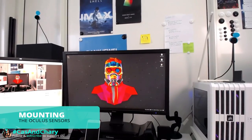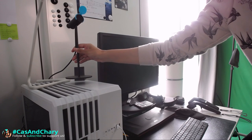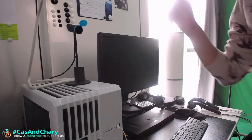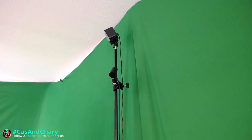The Oculus Home setup is pretty great and really gets the job well done. But if you still have some tracking issues, here are some things we do to get it as optimal as possible. We think it is better to place the sensors as high as possible with the sensors tilted down at a 45-degree angle. You can place the sensors on a higher surface on your desk, or use a wall mount and put the sensor high up on the wall. Mounting it high up facing down results in much better tracking quality.